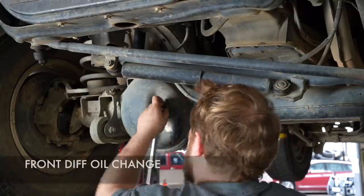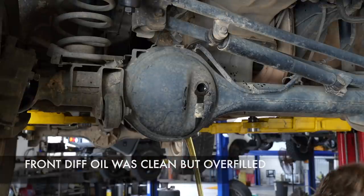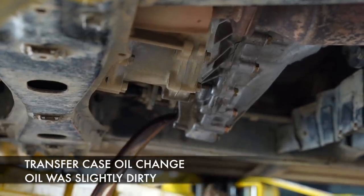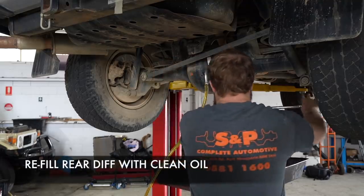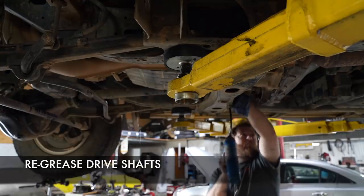I was thinking of doing this first service myself, but I just thought because I'm not a qualified mechanic and it's never been properly looked at, I'd come down here to get it done. Before this first big service I just wanted to do it with someone that knew what they were doing — Pat's the Patrol expert in town. So we're just starting with the oils first. We did the sump oil and sump filter, then we're doing the diff oils. The front diff oil was nice and clean, but it had been overfilled — we got rid of that and put some new stuff in. The transfer case oil was a little bit dirty just from use, so we got rid of that and put fresh stuff in. The rear diff oil was also a little dirty, which makes sense — in two-wheel drive it's being driven from the rear diff, whereas the front diff is only driven when you're in four-wheel drive.